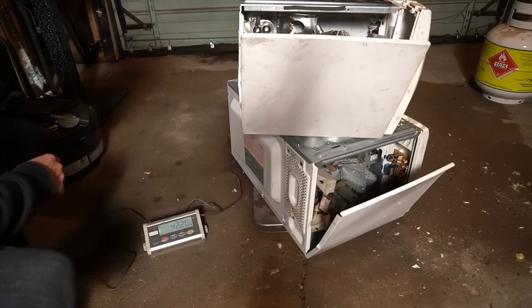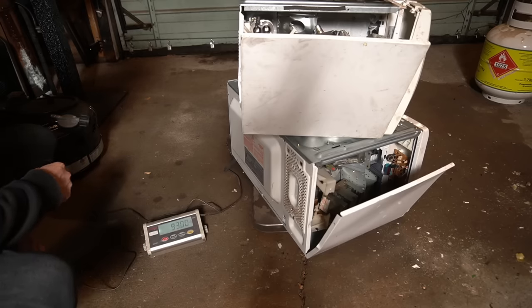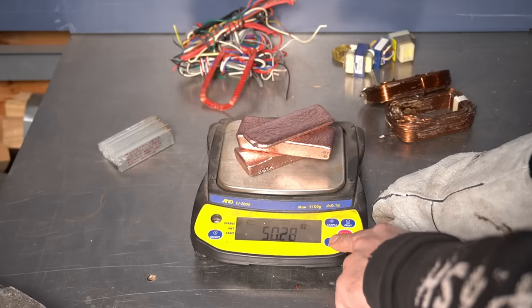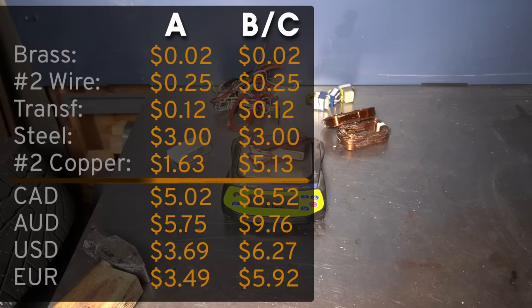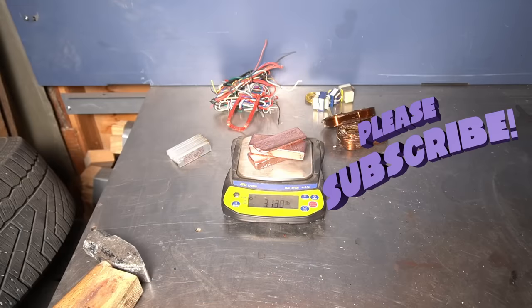Adding in the steel: 42 kilos or 93 pounds total, about 30 pounds of steel and just over three pounds of copper total. What I've been saying this whole time has basically been true — they're about five bucks each, as long as you don't get one where the transformer has aluminum windings on both sides. That's a pretty definitive answer: how much copper is in a microwave and how much is it worth in scrap. Like and subscribe for more scrap metal content — leave it better than you found it, keep doing the thing.